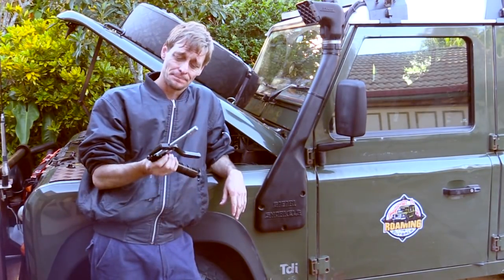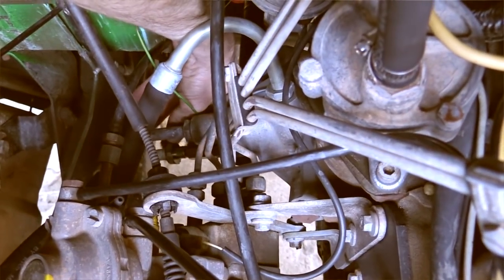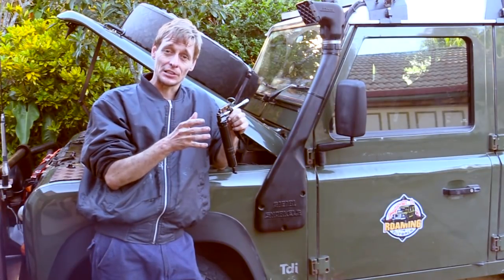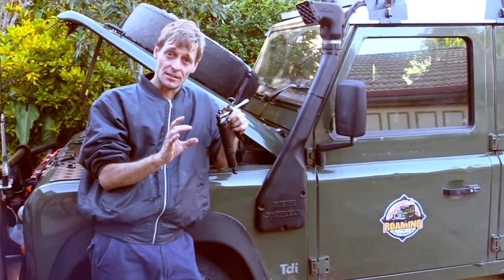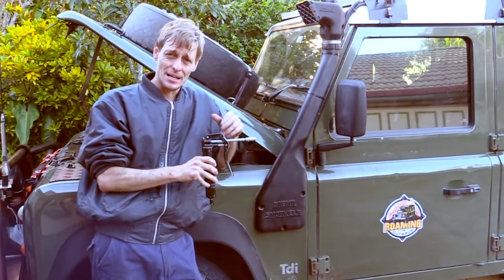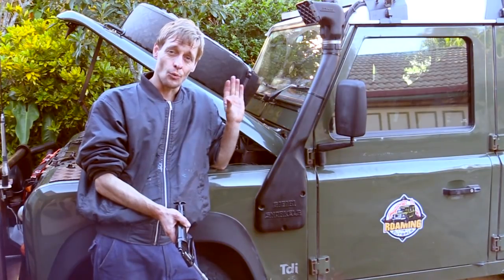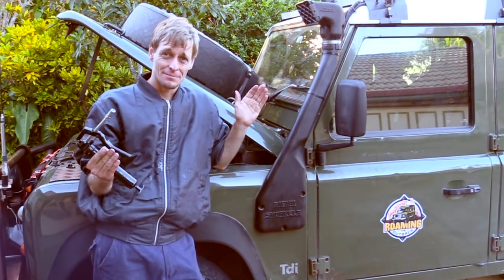The only issue I've found is my oil housing — where the oil filter screws on and the oil pressure sensor goes in. In the past I had an issue with it, snapped off the old adapter, had to drill and re-tap it, and that worked fine for a good year and a half. But I've checked it and it's gone loose and I can't tighten the adapter for the oil pressure sensor and gauge sender anymore. I've jumped online and found a second-hand unit to be shipped out. I could try to repair the thread with thread seal or metal putty and re-tap it again, but for reliability I don't want the sender coming loose and dripping oil everywhere. Other than that, everything appears to be perfectly fine underneath.